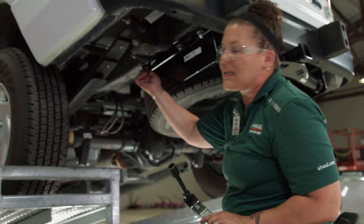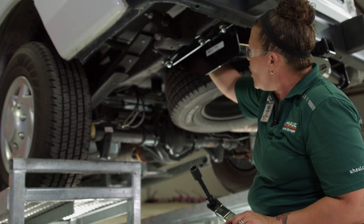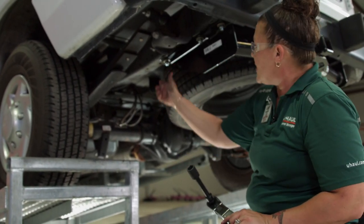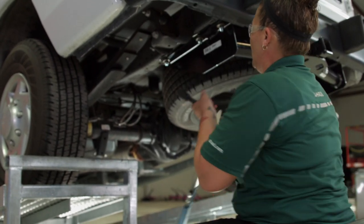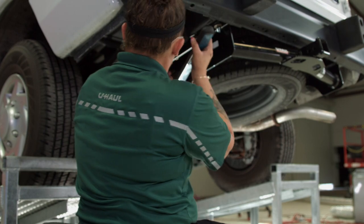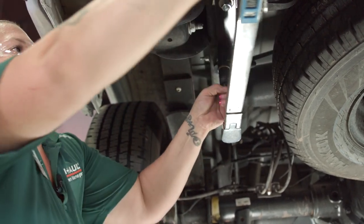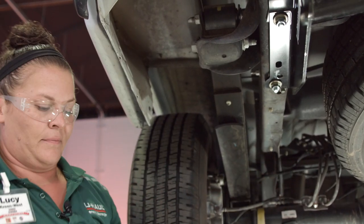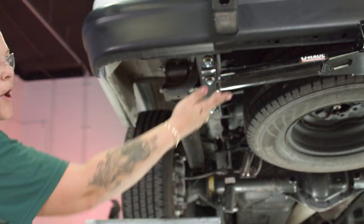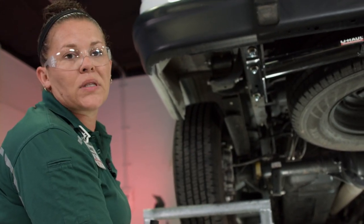Because the rear bolt is a locking carriage bolt — which you'll notice from your instructions on your hardware — we don't need to worry about it spinning because it's locked in place with the spacers we've put in. Pushing is always better than pulling if possible. We'll continue the same process on the passenger side until all of them have been torqued at 75 foot-pounds.